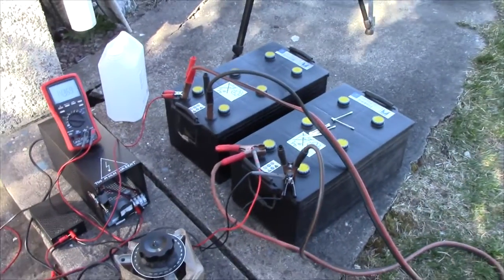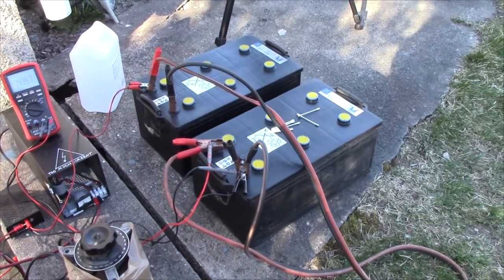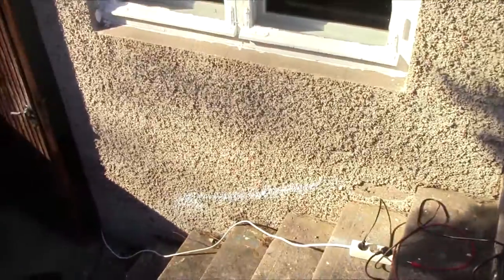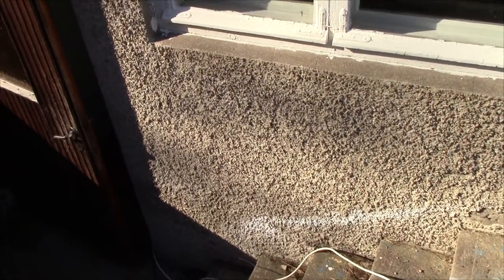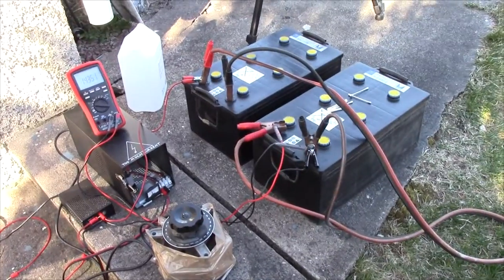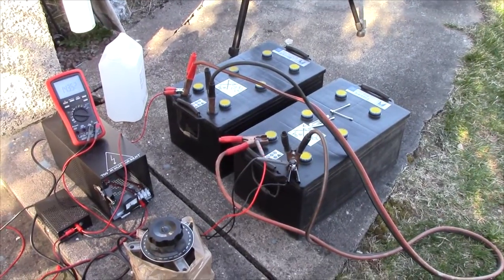And going for a system voltage of above 12 volts is tricky. Right now I've got four matching batteries, so to speak, these two and the guys indoors, which I could hook up for a 24 volt system, but I'm planning on pretty much just throwing in every random battery I've got laying around, so a 12 volt system is where I'm gonna start, and we'll see what happens.